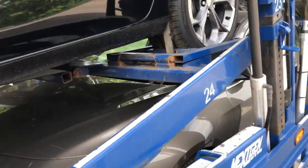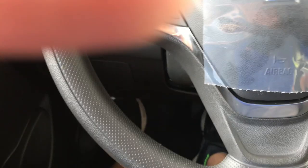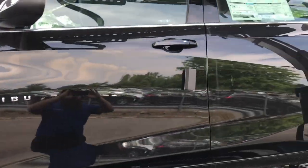For this car right here, I took all the straps off except for this one tire. Look on the other side — straps off over there, straps off up here. The key with this one is you're going to need to hop in. You don't have to start it, but you need to get it into neutral. Don't put it in drive because it'll drive off the trailer. Put it in neutral and put the parking brake on — it's front wheel drive. Alright, got that one in neutral.